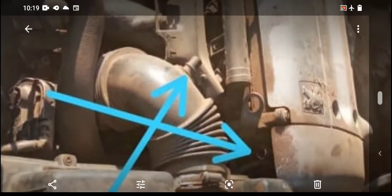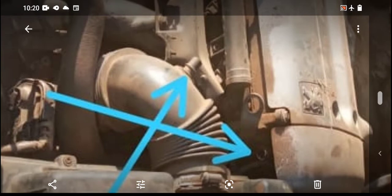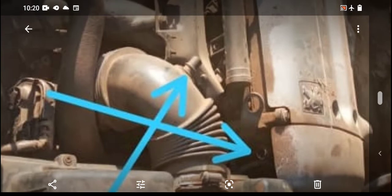However, this one on the tube, what this one will do is it will introduce dust. Right from here, dust will be coming in. You can even see the engine already is dusty. So all that dust will be coming in, going straight through the motorized throttle body, through the butterfly on the motorized throttle body, straight to the valves. Of course, it will pass through the intake manifold, then settle on the valves. Then the fuel that comes from the fuel injectors will wash down that dirt, those dust, that mud, down into the combustion chamber. And guess what will happen? As that dust or mud settles in the combustion chamber, it will be touching the, what's it called, the cylinder walls, which will also rub on the rings.